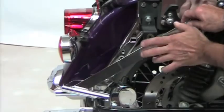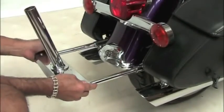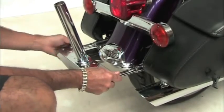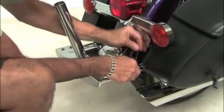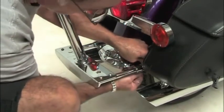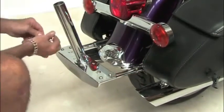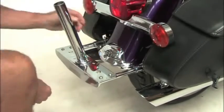That's the 2009 and newer models. When the holder is assembled, they slip the pins into the receiver brackets on the motorcycle. Slide that in all the way. It comes with two locking pins. You line up the holes in the receiver with the holes in the pins. Snap the clip on both sides. There you have it.